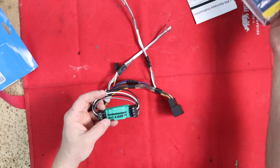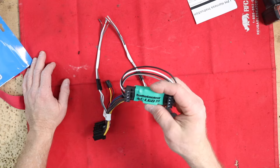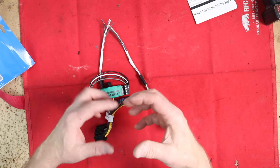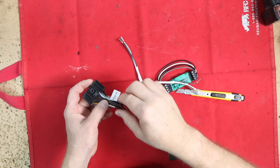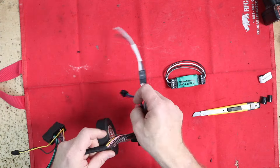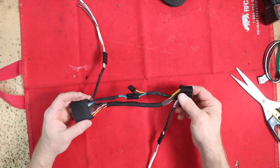We are going to be using a set of the AC LGD20s just for the front. This will come out of the amplifier side and attach here and then go off to that. For those who don't know what these are — these are load resistors. They're designed to give the amplifier in the radio a load so that it thinks there's a speaker connected and doesn't go into protection shut-off. Also, if it's a class D amplifier, it'll help stabilize it so it won't produce bad sound — usually in the high frequency range, like it'll blow tweeters. One thing I like to do is pretty up the harness to make it look more factory. I'll remove the sticky black tape, leaving about an inch to two inches at the top so it still has flexibility and movement. I like to keep the speaker wires separate so if we ever go in and change anything, it's easy enough to do.